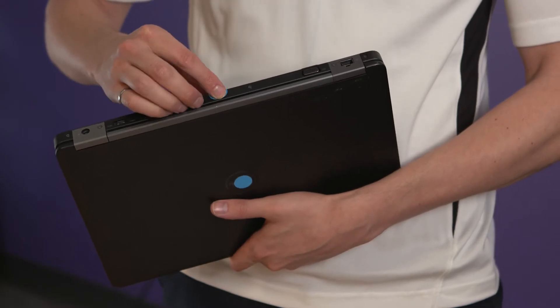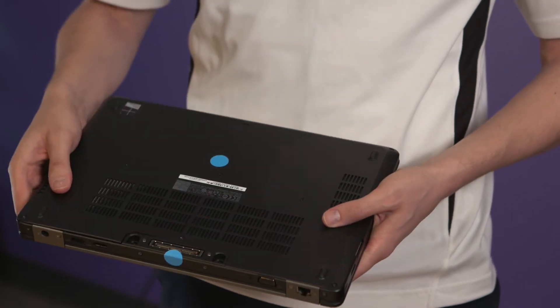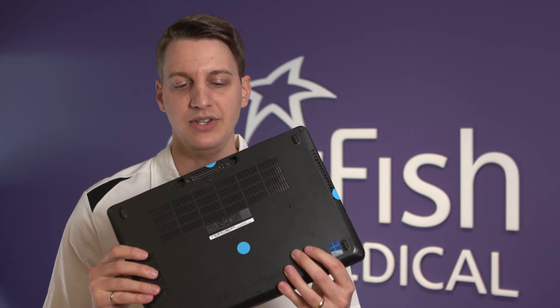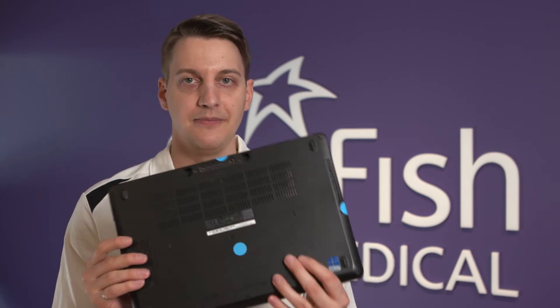The first thing we're going to do is choose a number of locations on the external part of the device for testing. Each part of the enclosure should be tested, and you might also want to pick out any spots that could be susceptible to damage via pushing or other means. I've marked four spots that I've identified as potential risks with blue dots to help target my testing. With this particular laptop, which opens and closes, we'll also do at least one test on the inside as that's a foreseeable use position.